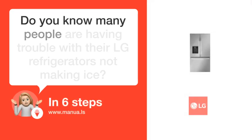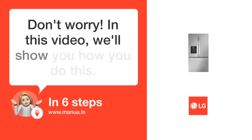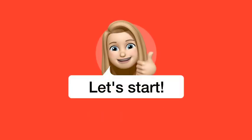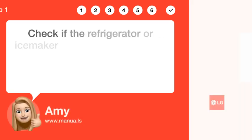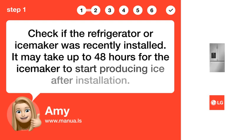Do you know many people are having trouble with their LG refrigerators not making ice? Don't worry. In this video, we'll show you how to fix this. Let's start. Step 1. Check recent installation. Check if the refrigerator or ice maker was recently installed. It may take up to 48 hours for the ice maker to start producing ice after installation.